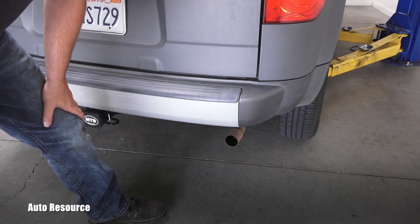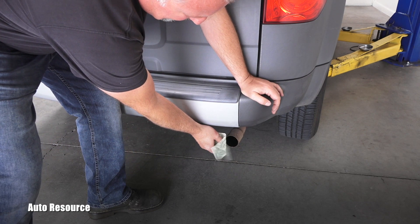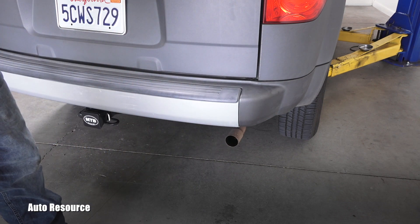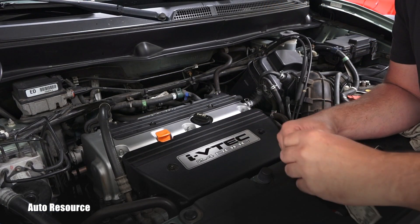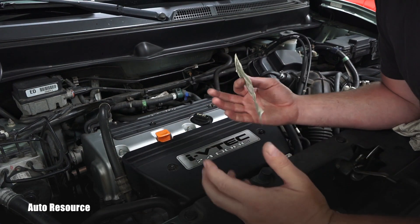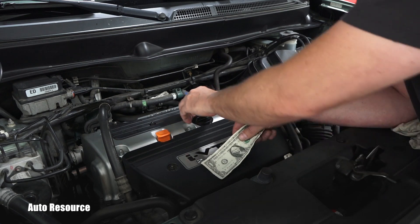It's running — you can see it's shaking. There is an uneven idle, and what some people do is put that paper next to it to show the fluttering. But let me show you a way better place on the car to see those symptoms. You can see that engine shaking; the idle is slowing down because the computer is dealing with this situation.